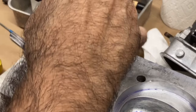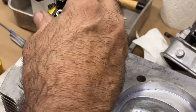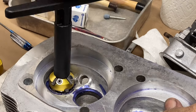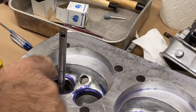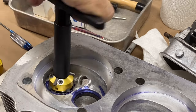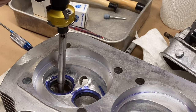Let's take a look and see. As you can see, that cleaned up — not quite, there's an area on this side that's not cleaned up yet. These valve seats — these heads have never been run, so this is how they came from the factory. Even a new set of heads could use the valve job. Still not quite cleaned up over here — we'll give it a little bit more.